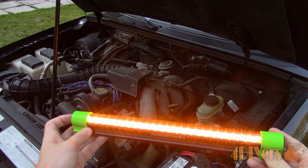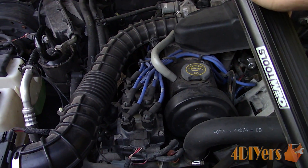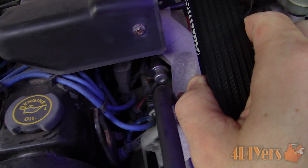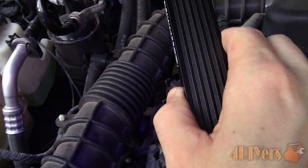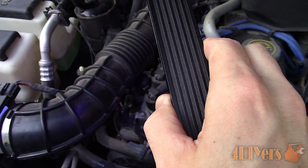Using yellow safety glasses will help spot the dye while also providing protection for your eyes from the UV light. Click through the modes until you activate the UV option and scan the engine bay. A UV light is needed to highlight the fluorescent dye that was added to the system.